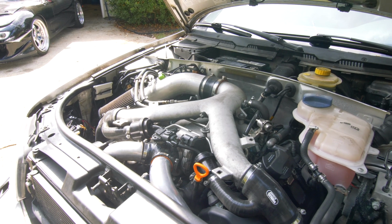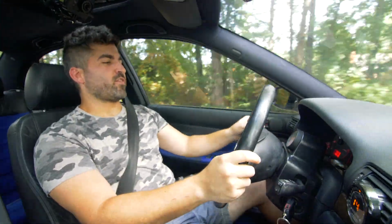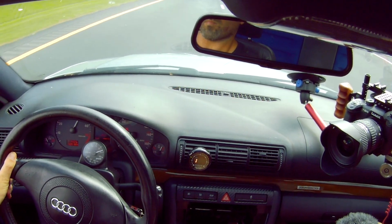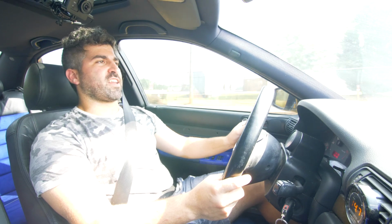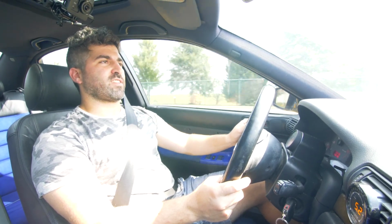So for those of you who don't know, this is a 2001 and a half Audi B5 S4. It has the 2.7 liter V6 with twin turbos, 30 valve head design, so that's 5 valves per cylinder. From the factory, it produces a solid 250 horsepower, but of course this one has been upgraded with RS6 K04s. Those K04s do make quite a bit more power than stock, and at 25 PSI, I believe this thing put down 460 horsepower to the wheels, which is pretty solid, and that was on 93. On E85, it actually put down a whopping 560. So this thing scoots. It is pretty quick.